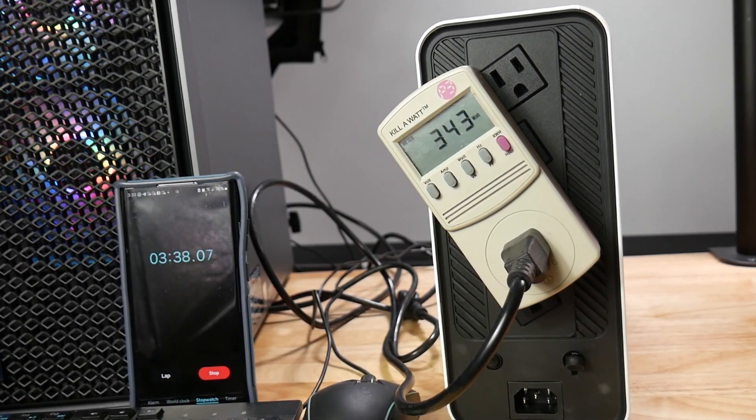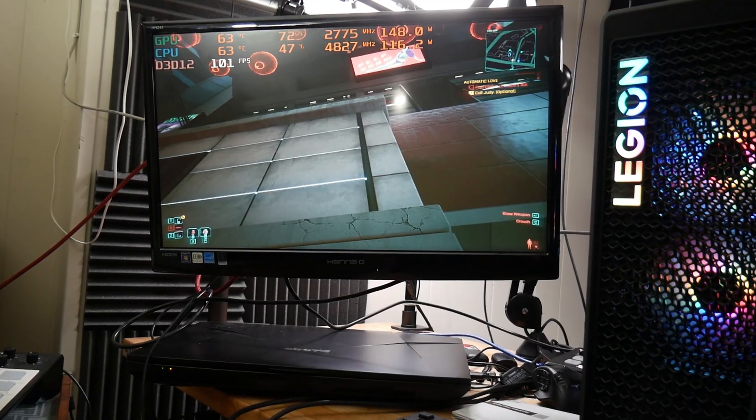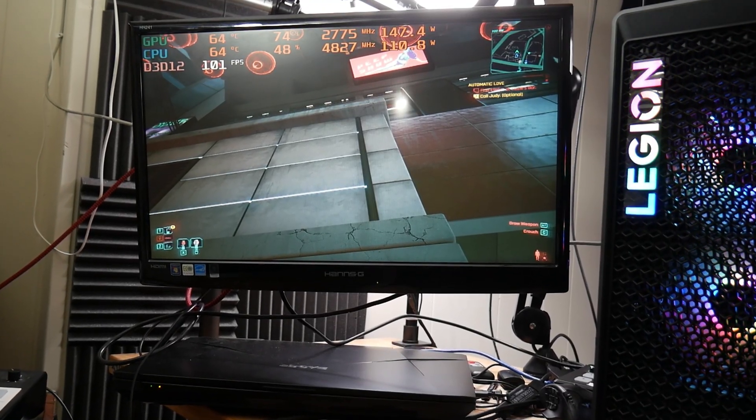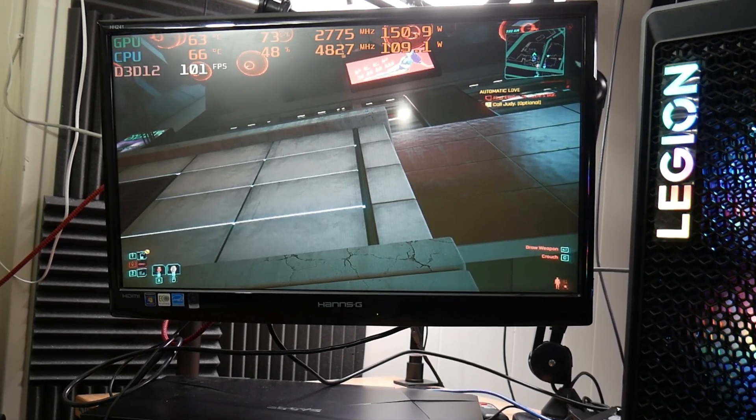My test was pulling about 340 watts and at no time did I lose my frame rate. I was actually able to play for 31 minutes in this situation, so if you have something less powerful, you should get a good run time out of this UPS. It does take a few hours to fully charge again, so I left it overnight. It's also not recommended to leave it in a discharge state for over 12 hours, so it can maintain a good charge capacity.